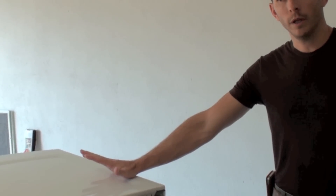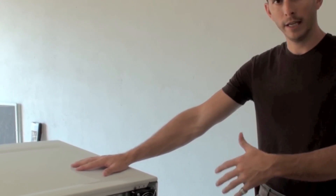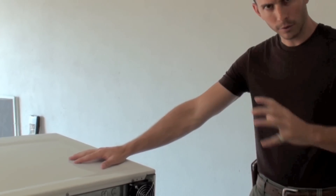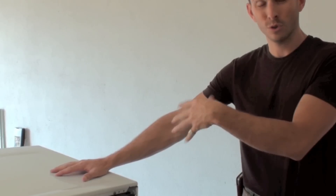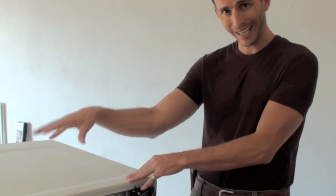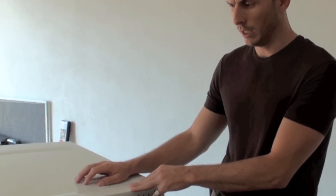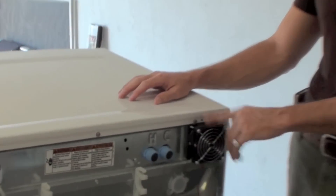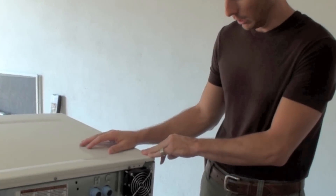The moral of the story is whether you smell something in your machine or not yet — do yourself a favor, get a washer fan kit, get it installed. It runs continuously and will circulate air through the machine. Whether how bad your mold is right now in that internal discharge hose, it's up to you whether or not you want to replace the hose or try to clean it. If you install the fan and do nothing with the hose, the smell will be gone in a day or two, and over time without that mold growing anymore, it will start to flush itself out. But without doing all that, the washer fan will stop any more future mold growth and get rid of the odor — and even more importantly, get rid of that black mold so it's not continually coming in contact with your clothing every time you do a load.